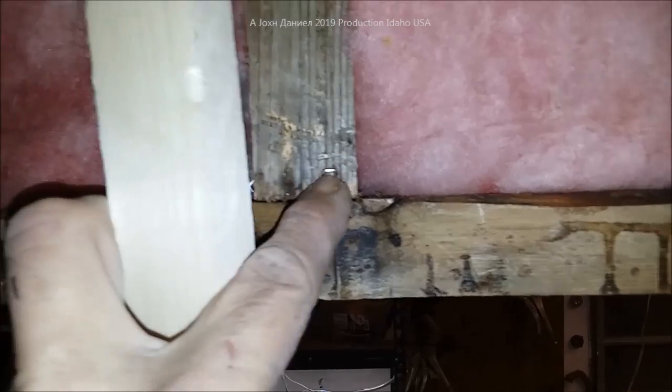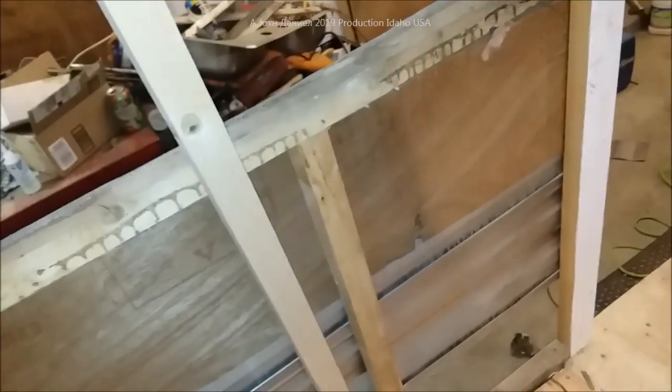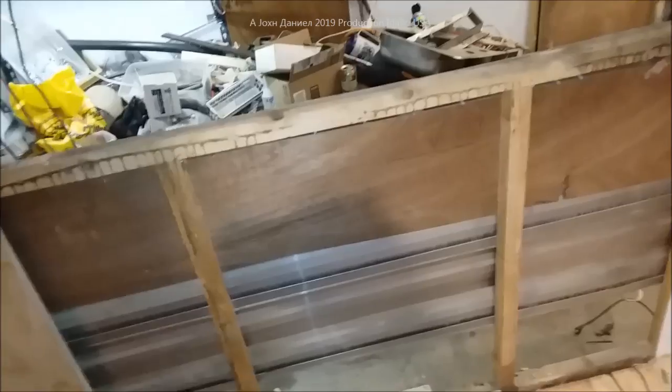So you'll see how that joint's just made with some staples, and I threw a few in there to tighten it up, but that's all it's made with. So we'll have a connection here as well as onto that one, and same thing here. And the whole trailer will be done that way on 16-inch centers. Now the 16s will not hit everywhere. Some will be here and other places, but like in the window, we'll run a 2x2 up behind it to make it all strong and stout. So what we end up with is occasional staggering of the joints, but 16-inch centers.